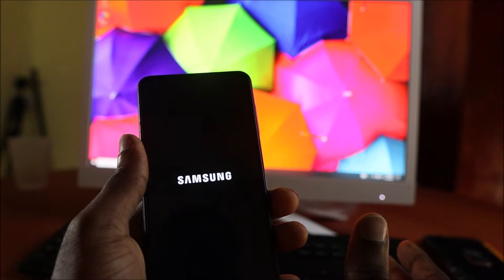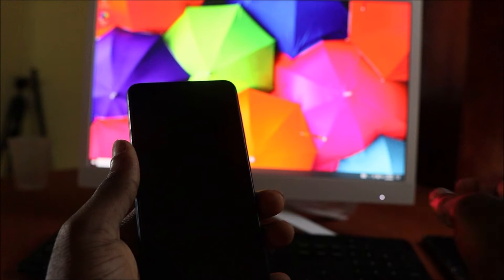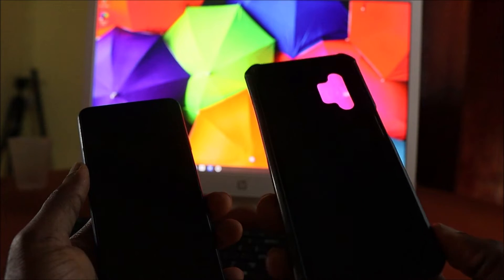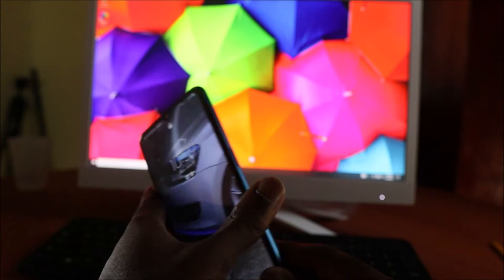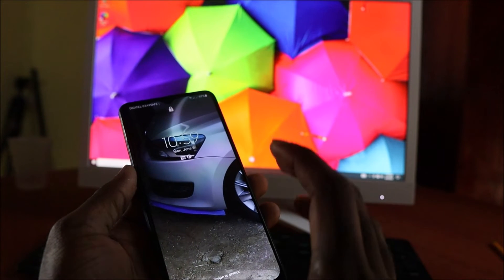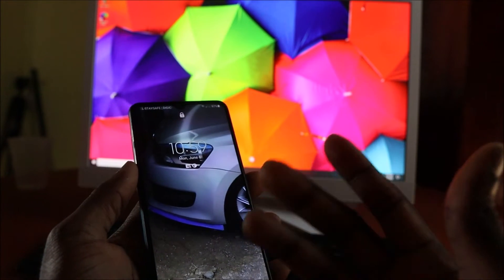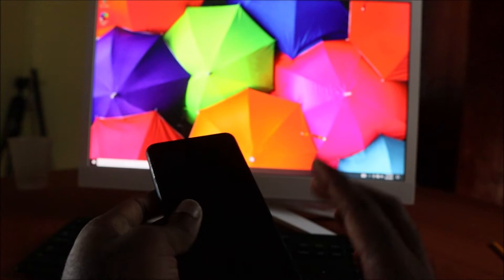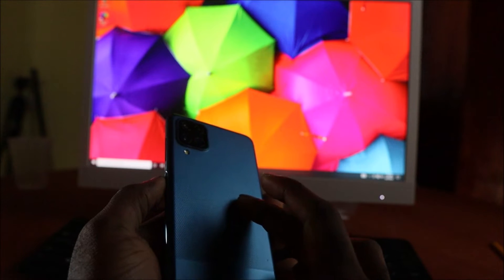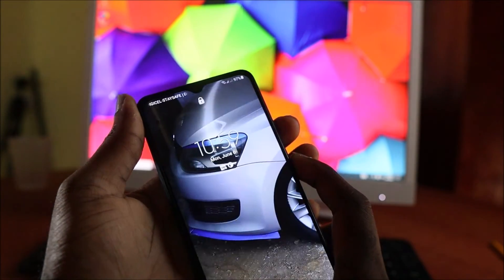If you drop your phone in water — I dealt with this a few days ago where I revived a screen from water damage. The phone got wet and water got into the case as well. We took the back of the phone off to ensure there was no water inside. Only the screen was affected. We took a heat gun and gently heated up the screen, allowed it to cool down, then repeatedly did a force restart and unplugged and replugged the battery. That revived the phone.